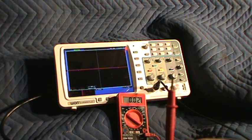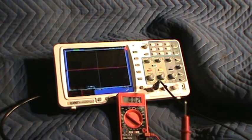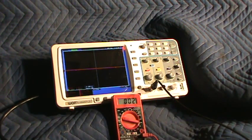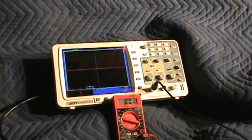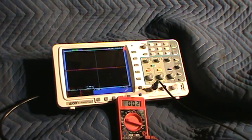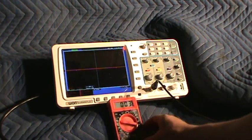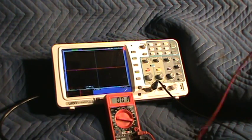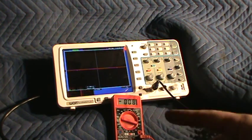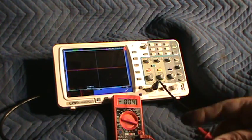That's what we're talking about with ghost voltage. A real easy thing to do when checking for ghost voltage: if you're plugged into a wire and you get that reading, drop the range down so it reads smaller measurements. Now shake the cable around and you see how much it's jumping — it jumps from minus 10 to plus 10, all over the place.